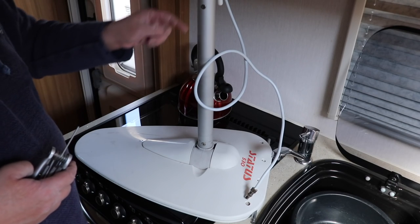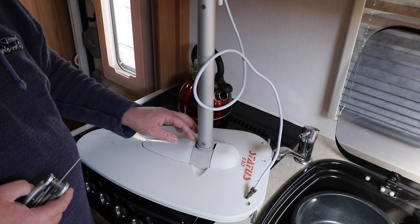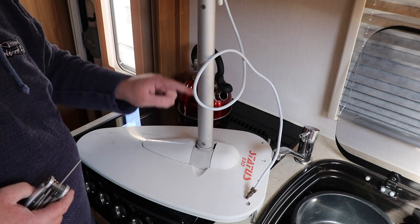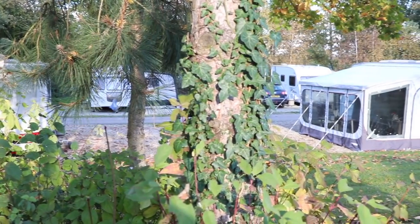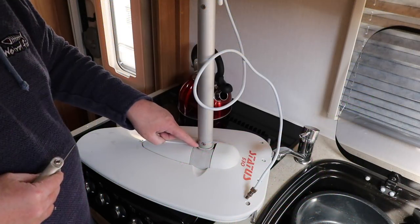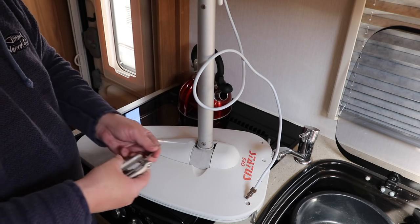Let me show you the antenna in greater detail and what I thought the problem was, because it may be what you're suffering from too — ours is a little bit more significant. In this tube here, there are three O-rings mounted up here, and I thought the problem was water getting in past those O-rings and dribbling down this tube. Our problem started last year back in October — you can see our caravan has the antenna mounted vertically, which would allow water to get into the tube.